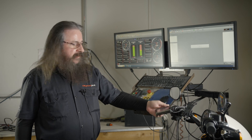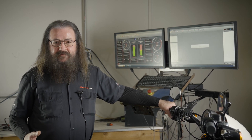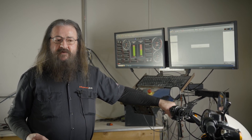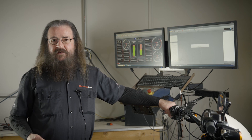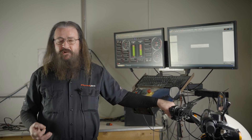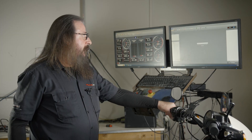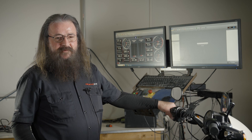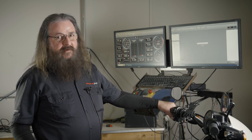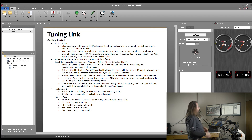We're preparing and writing the ECU now. As we start running this bike, you're going to see that the benefits are going to be accuracy and speed — you're going to be able to do this much faster in your shops, making you more efficient, putting more money in your pocket, and getting the best possible tune out to your customers. Now we've got it prepared. We are going to cycle the ignition switch — you want to give it at least 10 seconds to make sure everything resets. I would recommend 15 seconds just for a little safety margin; we don't want to do any soft bricking of your ECMs. Come back on with it, tell it okay. The tune has been prepared and now we're in TuningLink.